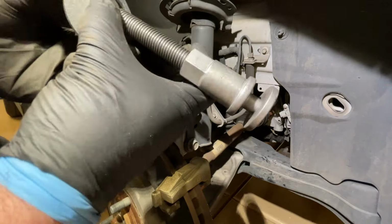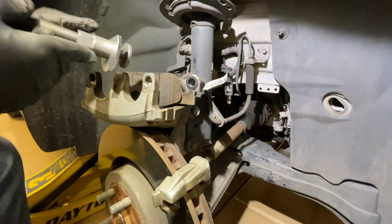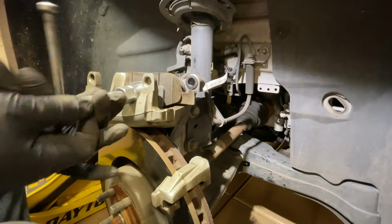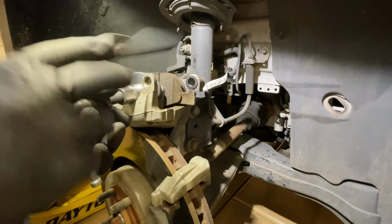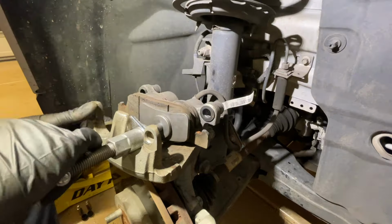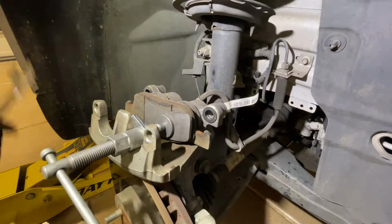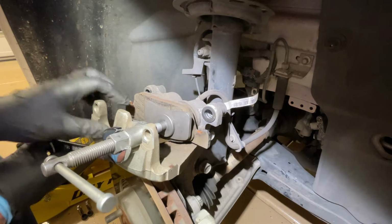So for this tool, and I have a link in the description of how to use this tool more and where to find it, we're going to put our first blocker in here that's going to go against the outside of the caliper. And now as we twist this in, it will spread and it will make contact with the brake pad. And I like to leave the old pads in. That way it will push these calipers in and push those pistons in at the same time a little bit more evenly.